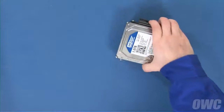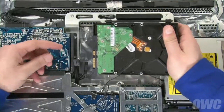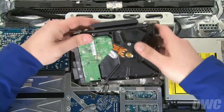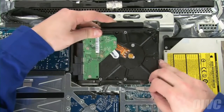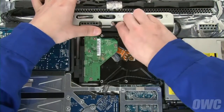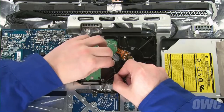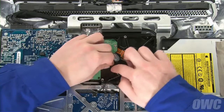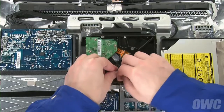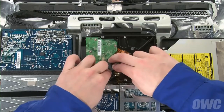The new drive is now ready to install. Reattach the power and data cables to the drive. Then slide the lower mounting pins on the drive into their grommets in the iMac. You can then lay the drive flat into the iMac and push the top handle down until it latches into place. Place the heat sensor with the flat side down in roughly the same place as on the original drive, then use the bracket to hold it in place — there should be enough leftover adhesive to stick. Replace any excess wire back like it was before. If the tape is no longer sticky, use a piece of Kapton tape to hold the wires in place. Finally, re-adhere the foam pad over the sensor assembly.